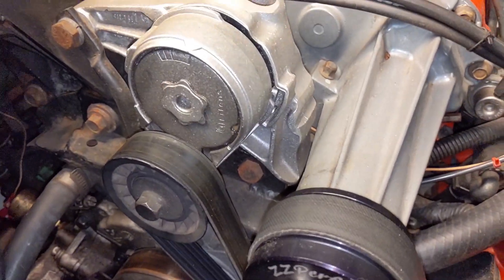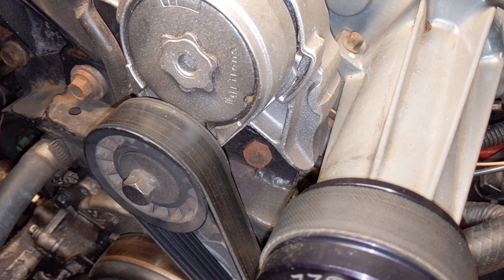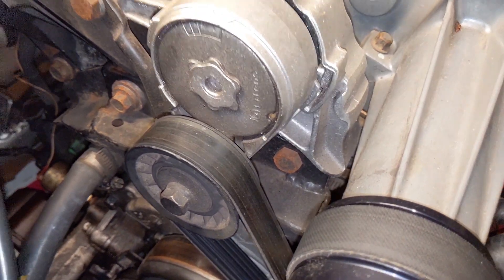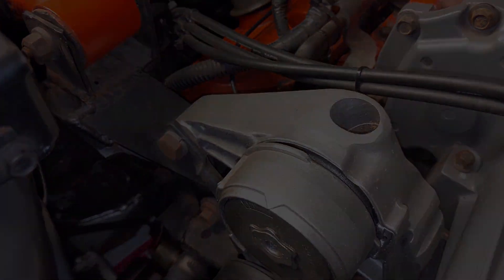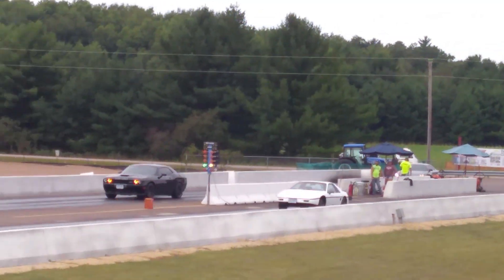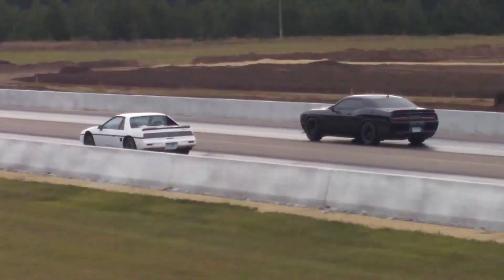This is the original tensioner off the Buick Regal. I modified it by cutting the bottom part off and discarding it, then fabricating the mounts out of metal to attachment points where I could bolt to the engine. This is a tricky part of the build and you'll have to do a little more research to figure out how to get it done for your particular engine. That's a wrap on part three of the Fiero 3800 supercharged closer look. Stay tuned for part four coming soon — please hit that like and subscribe button, and as always, thanks for watching.